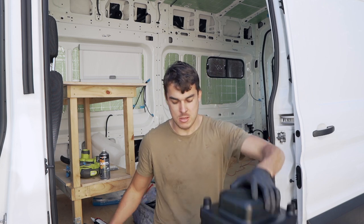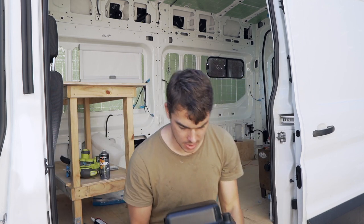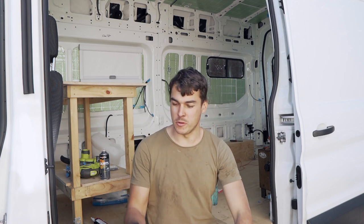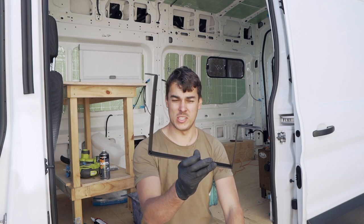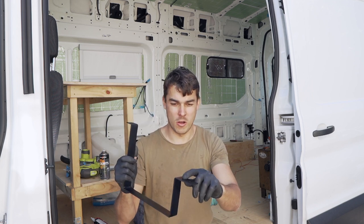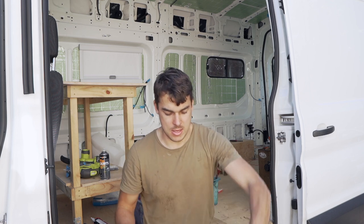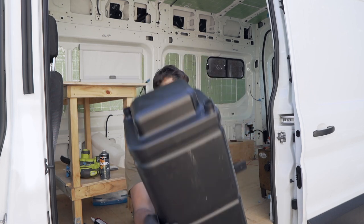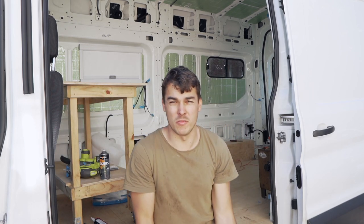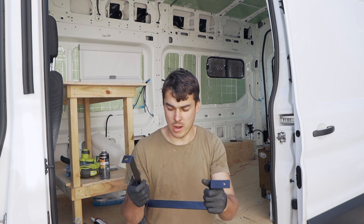For the greywater tank, it's a bit smaller and not as heavy — only going to be 45 kilos when full and it probably won't be full that often, so a little less heavy-duty. I've made a bracket that fits the contours of the tank. It connects to the original fuel tank bolt and I've drilled two holes where tech screws come up from underneath and screw into the chassis. If there's any play, I'll put a bit of yoga mat foam on the bottom and top to make it snug so it won't rattle.